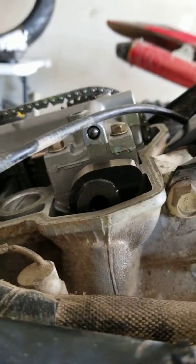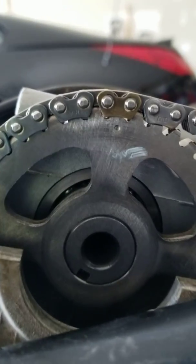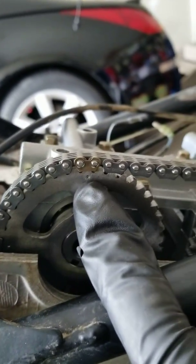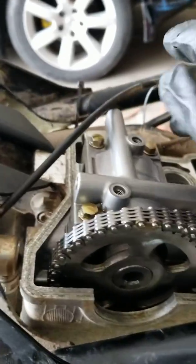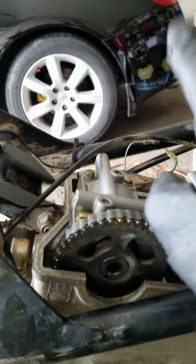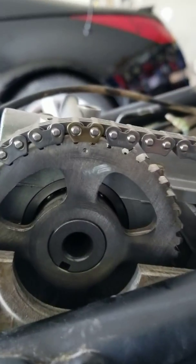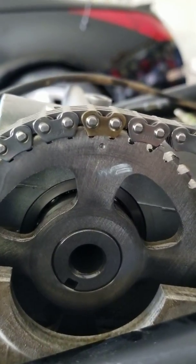Cam lobes should look something like this — like 10 and 2. Now here was the pain. It said online about these gold tabs on the timing chain — they had to be on the top dot for each cam. What I did was I took out the spark plug and I rotated that mag over there until I got that nice gold piece on top of each cam like it stated.